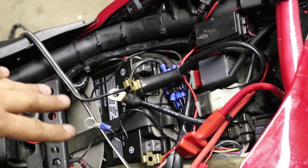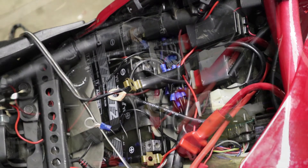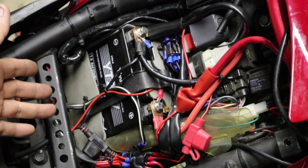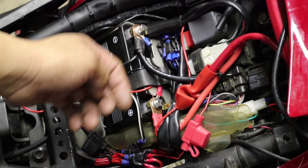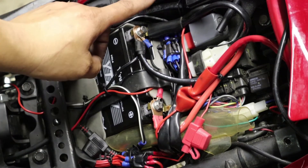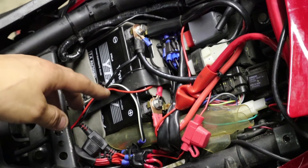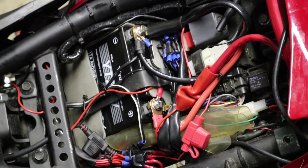As you can see, everything is nice and tucked. Go ahead and put your screws back in — negative and positive. And that's pretty much it. Now that the screws are back in, it's so much neater — no more bulk of cables. If you ever need to work on something, all you have to do is find the cable, disconnect it from the negative and from the positive, and remove it without worrying about removing the bolt and having a bunch of cables fall out. And if later on you want to connect something else, just go to an unused terminal, connect your positive and negative — easy access.